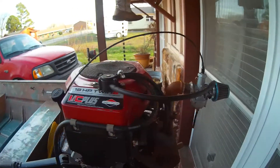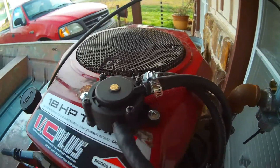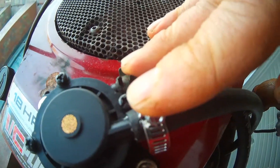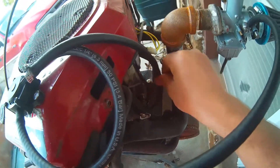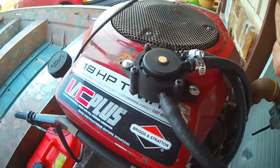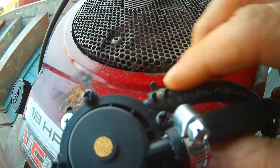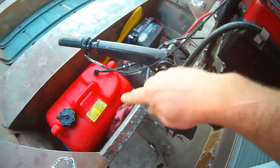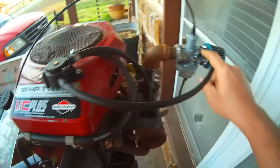It's got a little basic air filter on it. Mounted the pulse pump up here, in case anybody wonders how these work, because they're not labeled. You've got two together — this one up here on the top is from your vacuum out of your crankcase or valve cover, whichever you want, that makes it pulse. And then this one beside it over here is from your fuel tank, which comes around. We've got the brackets that go to that. And then the one here all by itself goes out to the carb.